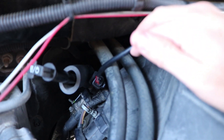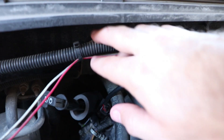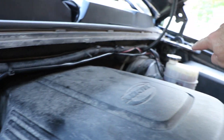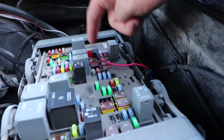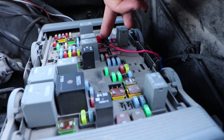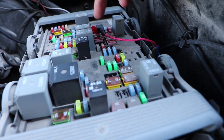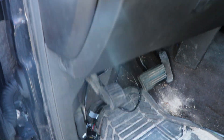It was really easy to install, honestly. Just put it up there. I zip tied it up to the dipstick for the transmission and it's not going to go anywhere. Now I ran it across — other than these nasty wires right here — I ran it over to the main fuse box. Unfortunately, this is the only switched power I could find: it's number 43 on the fuse box. It doesn't really matter which other one there is, if there's any other switched power, but number 43 on the fuse box is switched power for the gauge. I wish I could have found switched power inside this fuse box right here, because that would have been a lot easier to run everything. And I had to drill a hole through the firewall just to let the wires go through.